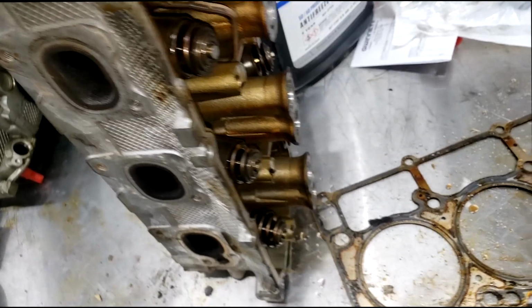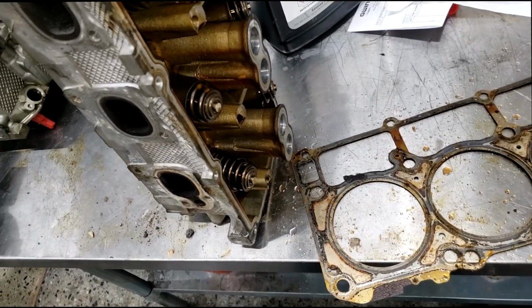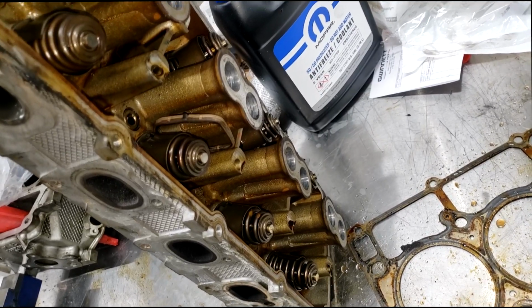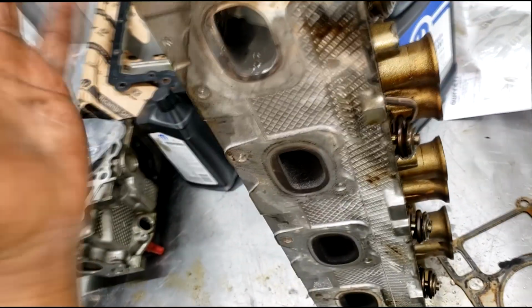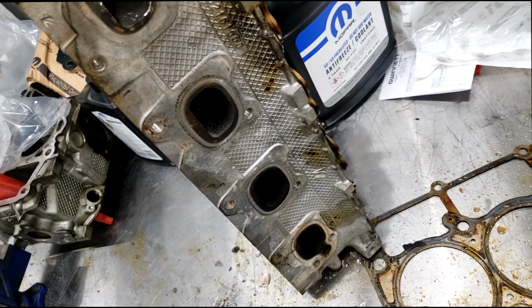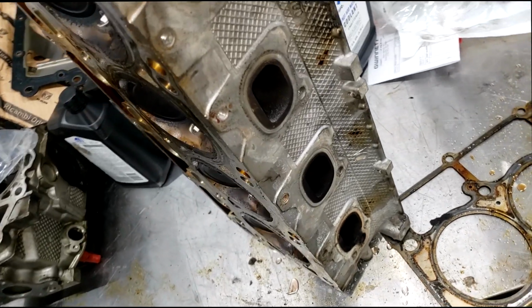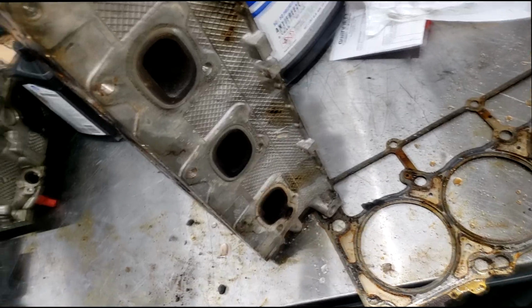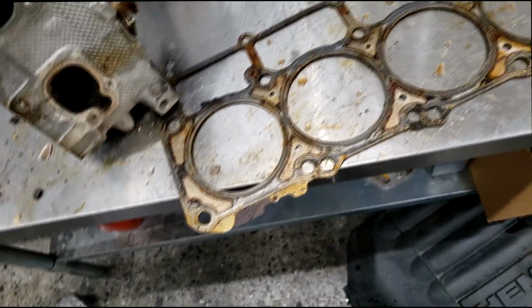You can get it with a quarter, not so much. You don't even have to be in the red zone overheating. You can be a quarter before the red zone, and it's almost history. That's too late. If you have something like a PT Cruiser and you have a nagging overheating problem, guys, I see it all the time. I go over there, I replaced the radiator, water pump, blah blah this, blah blah that, thermostat, and I'm still overheating. And naturally in the comments you're going to see it's a blown head gasket.